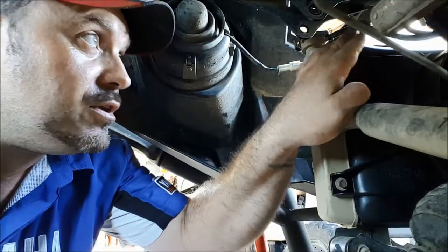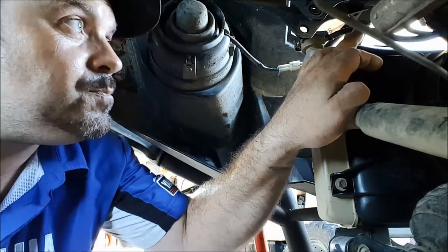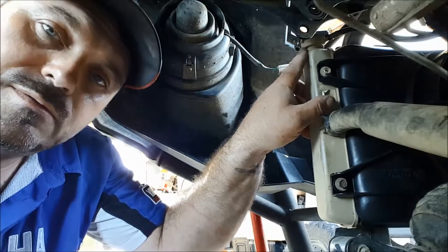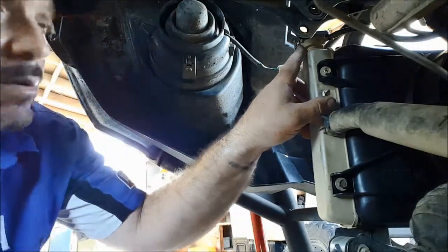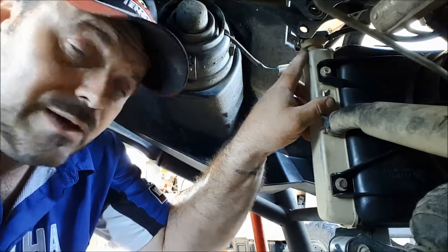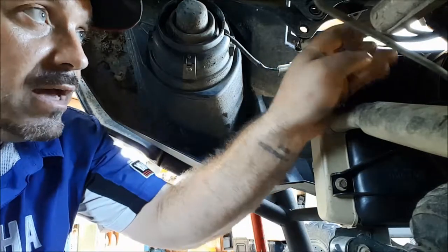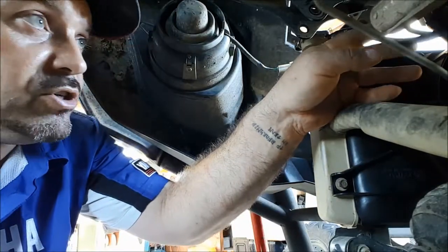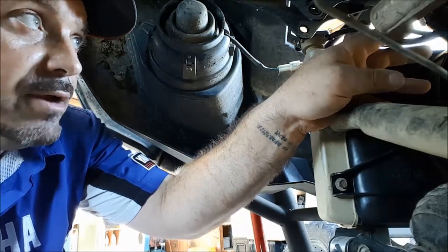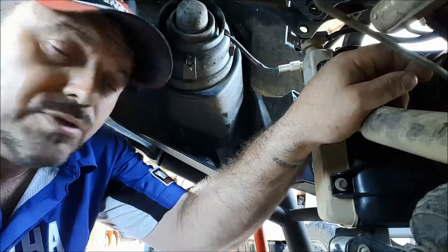So just off by the radiator cap there is the overflow pipe that goes down to the coolant reservoir. Now, if the coolant system gets overpressurized, there's a release valve where this radiator cap fits. Built into the cap is a pressure relief valve. If you look at my coolant systems diagnostics video, you'll see how that works. So if the system overpressurizes, that valve will lift and coolant, under quite high pressure, will head off down to the reservoir tank. Now, that's fine if the zip ties are a little bit tight on that pipe. The pressure will force the coolant through.